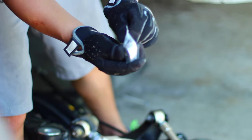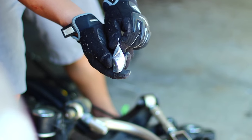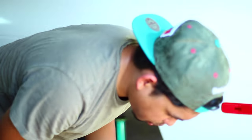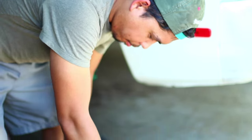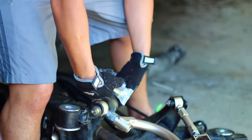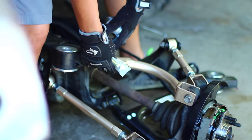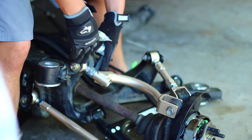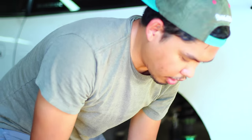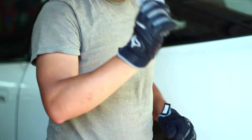You can also see the difference: the washers are really really thick — about the size of at least three quarters stacked together, just to give you some reference. The idea is that these bolts will lock both pieces in place together, so that when you're going into a corner really fast your suspension isn't flexing and changing your alignment, which would make buying adjustable arms pretty much pointless. You want everything to stay put and keep the car planted to the ground.